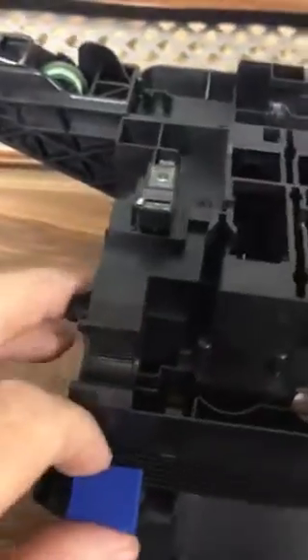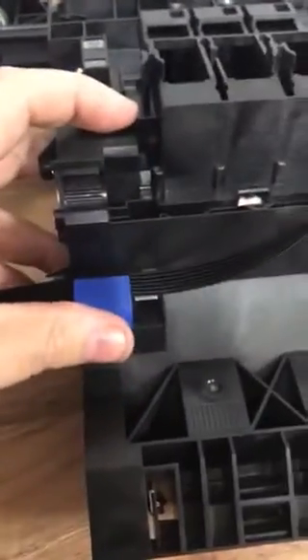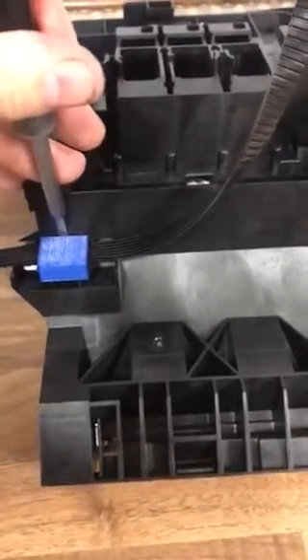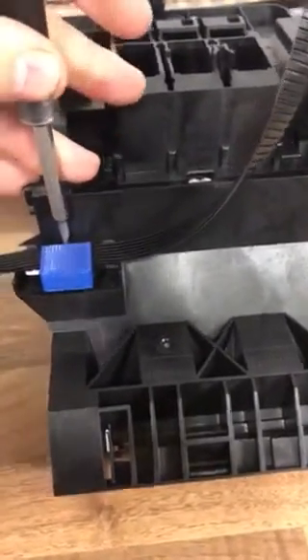From the top, make sure you put the rib down. I'm going to feed it in and then feed the belt down. As you can see, job done. And that does the same job but even stronger than the original design. And if you need to take it off, just get your screwdriver in and twist it using it as a lever, and that will pop the belt off.